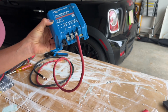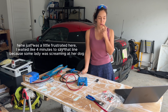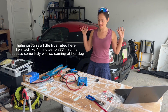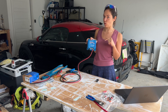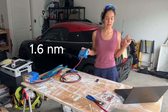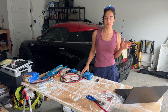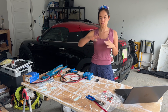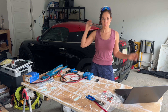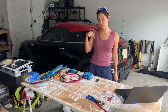It's really important that you use torque. According to the manual, it's 1.6 newton meters. There is a lot of power going on here and you want to be tightening these according to spec. If you don't know about torque, I literally have the most amazing digital torque wrench. It's small enough — a lot of the torque wrenches on Amazon are for lugs and stuff. I took my time, I found one, and I'll link it in the description.